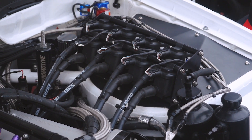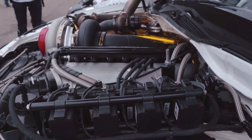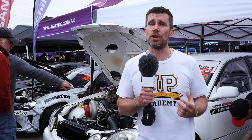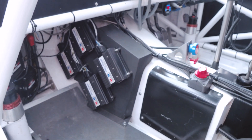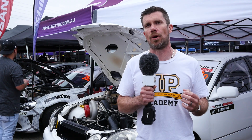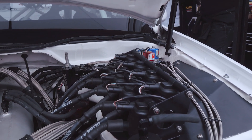When it comes to the ignition system on a rotary engine, it requires a lot of ignition energy to reliably ignite the air-fuel charge, given the rich mixtures that rotary engines like to run. Here Carl has chosen to use four M&W Prodrag 2 CDI boxes, which control the coils mounted on the passenger side strut tower.